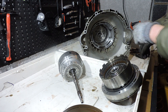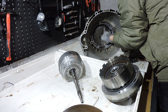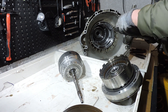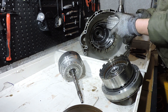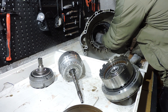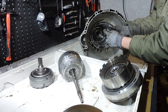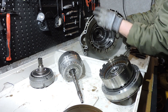Now we gently take the planetary gear set out — no preparation needed, it just comes out. We have the little gear, a thrust bearing on the other side, and a ring around it. We're going to put this right here behind the other combination of pieces, making sure we have the other side of the thrust bearing facing outward. This thrust bearing actually has an edge — the edge goes inside the DG drum, so the flat side should be looking outward, on which you put the other side of the thrust bearing.